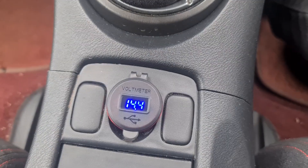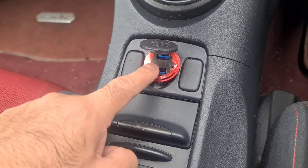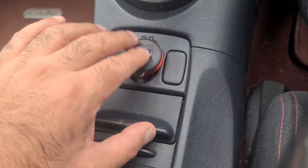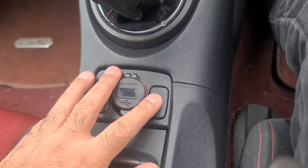And that is that little modification all done. That looks lovely, I think. These USB ports, interestingly, if you switch that off, not only does the voltmeter go off but the ports switch off as well. Which is quite good because if there's some sort of voltage drain, you can actually isolate this and know that it's not causing the drain. Not that you'd be able to check the volts whilst you're checking for your voltage drain anyway. So that's all done and I think it looks lovely. That little USB port — I think it was a worthy addition to the car. Beats having that cigarette lighter in there, not that I had a socket in there anyway. I don't know what the previous owner did and why he removed it, but I saw it as an opportunity to upgrade. So I hope you enjoyed that, I hope you took something away from it. Maybe you'll fit one to your car. Give us a thumbs up, give us a like, subscribe to the channel for more juicy videos. I shall see you in the next one. Bye for now.